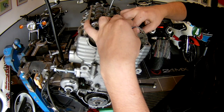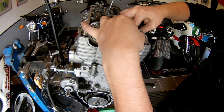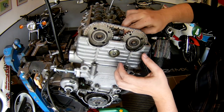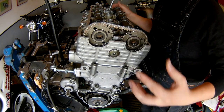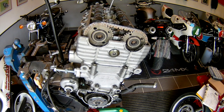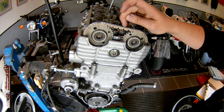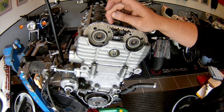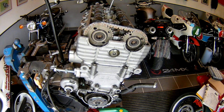As you can see, I mislocated the exhaust side a bit, so I'm trying to get this right now. It can be a bit of a hassle to get both camshafts aligned in the correct position and also have the proper number of chain links in between them. But this looks fine now.